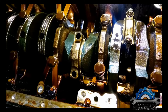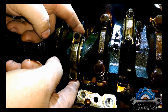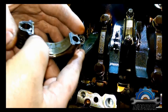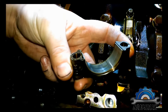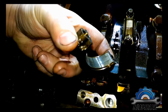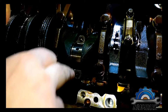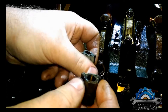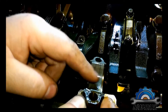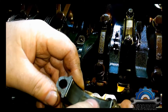Only get OEM bearing cups - don't get any aftermarket unless you're building a proper proper engine and the parts have good reviews and recommendations. Cheap aftermarkets I don't recommend. What we see here is a bearing and it's not looking good - it's worn. I don't know about the crankshaft journals, but this is not looking good. It's discolored.